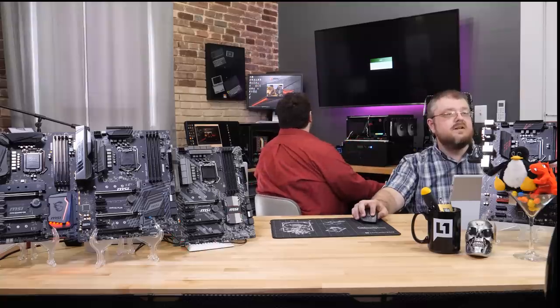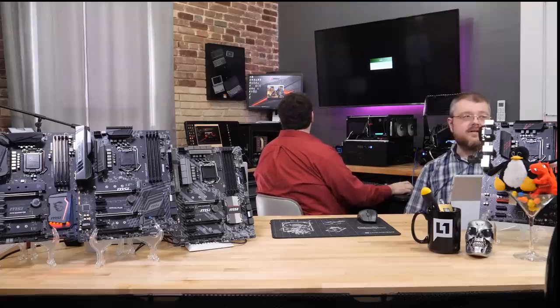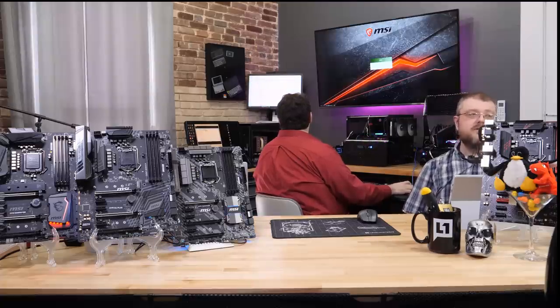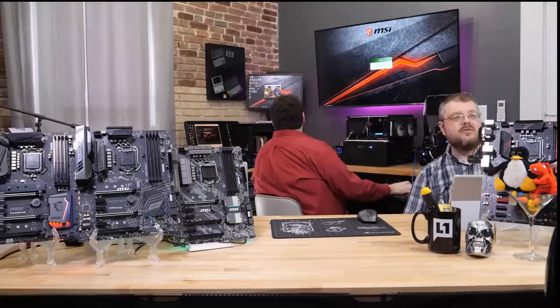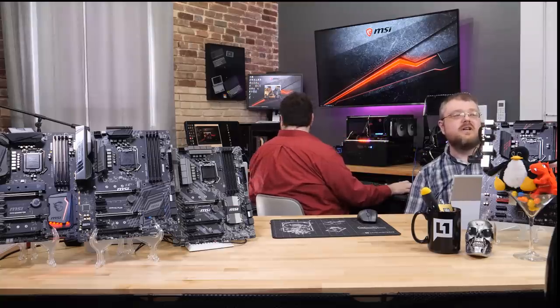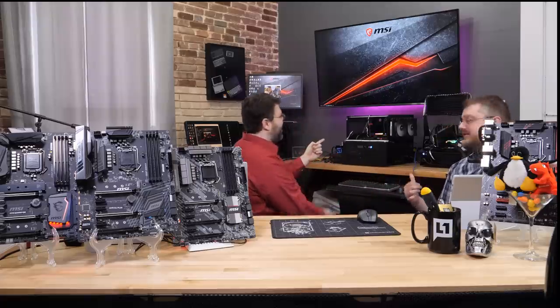Okay, so let's talk about, are you going to do the Godlike Gaming first? Yeah, I guess so. So we've got the i7 8700K that we talked about earlier in this machine, the Godlike Gaming motherboard, G-Skill Trident Z DDR 3600 RAM, OCZ RD400 NVMe, a Corsair H115i for the cooling. Like we said, we have only liquid cooled these. We did not try any sort of fan cooling. They're very warm. Thermaltake 650 power supply and a GTX 1080 Ti. So that is what you're looking at right now on the TV.